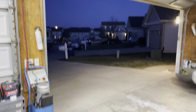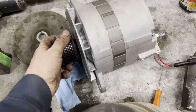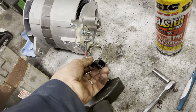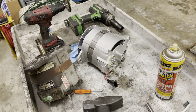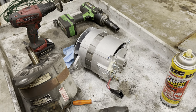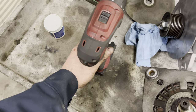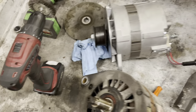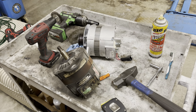Starting to get dark outside, but I've got the new pulley on. The nut's tight. The spacer's in, the fan is in, and it spins perfectly smooth. Got the little connector back on the back. We're going to go put it back in the RV and hook up the battery cables — positive and negative. I'm also going through and cleaning all the connecting surfaces with a wire brush and then putting some dielectric grease on it, just to make sure we get a perfectly clean contact with no corrosion in the way.